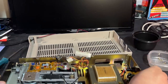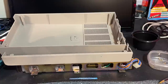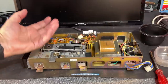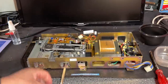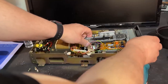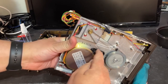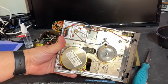The plastics go into a bath of hot dishwasher soap water. I'm going to take out the actual drive from the metal case and take a peek underneath to clean it as well. There are just two screws on each side. There it is — and this drive has a belt. The belt looks to be in very good condition, so no issues there.